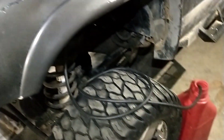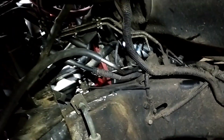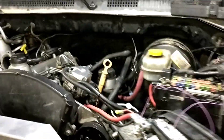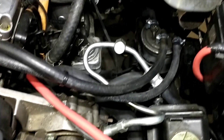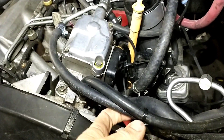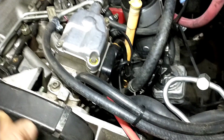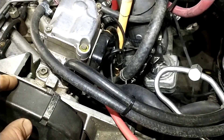I'm just going to let it run here - you will be good to go and you don't have to do anything else with the fuel system. I'll plug this line into my other line right here, and that will be the end of my fuel system hookup. The fuel system comes right up here to my injection pump. I did the same thing on the PD, and I don't think the tandem pump needs a specific pressure either, because that H setup gives it a couple of PSI at most and it is working perfect.